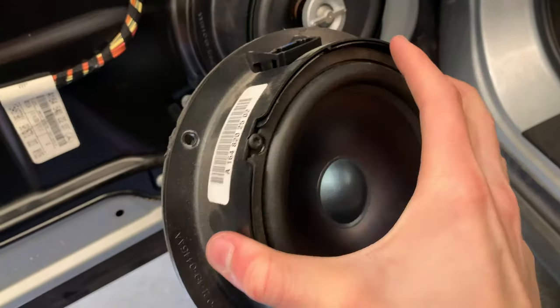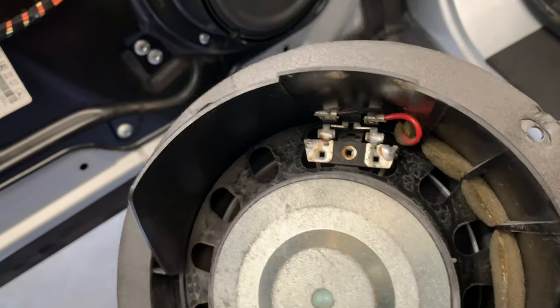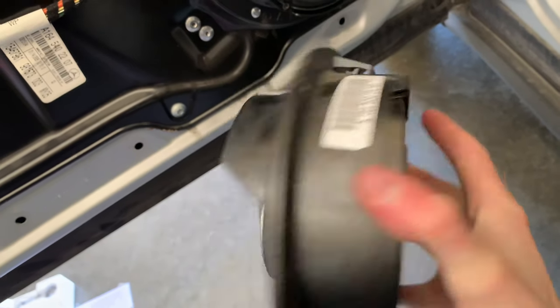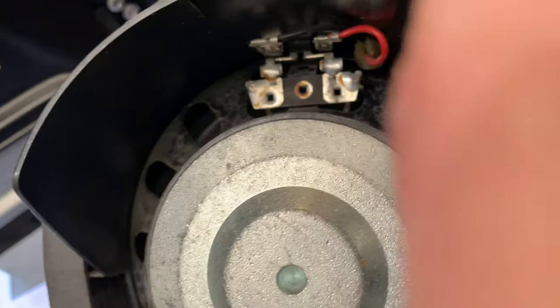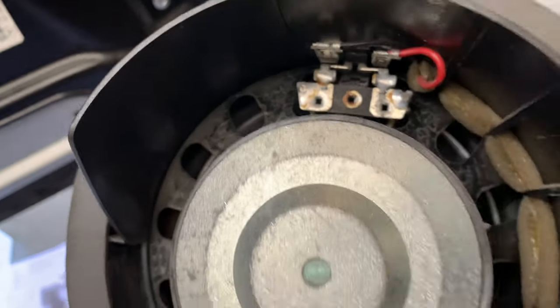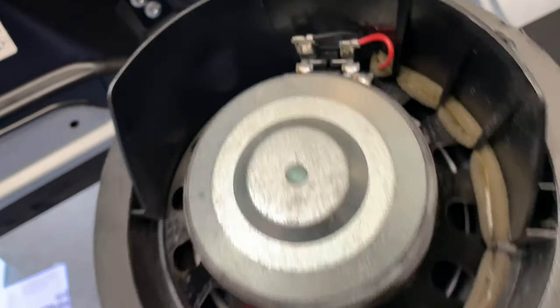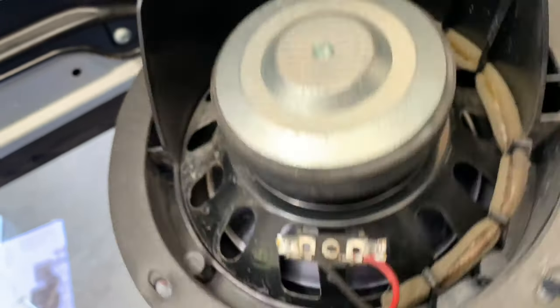So from here, what you will do is disconnect, unscrew all of this, and start prying up the speaker with the screwdriver. And then while you are prying that up, you want to take a soldering iron and unsolder those two connectors in there that connect to the actual speaker. Now leave the other cables, and these ends just simply slide off with a pair of pliers, leave them.